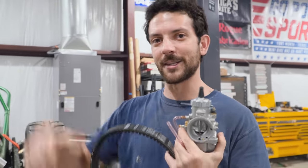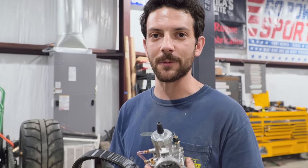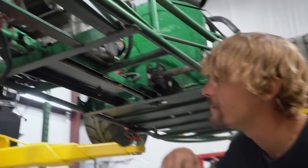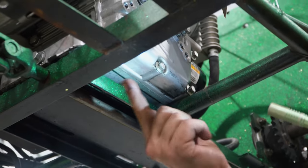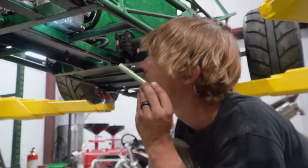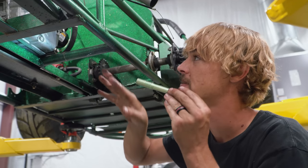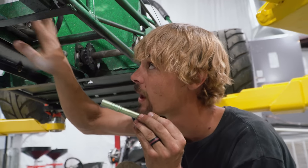If you want to check out the 780 torque converter or 34mm carburetor, there are links in the description to gopowersports.com, and anytime you place an order let them know in the order notes that Cars and Cameras sent you. Now that we've got the engine lifted up and the torque converter taken apart, we noticed an oil leak — it seems like it's the side cover gasket. We wiped it and it's still coming up a little bit, and it dripped quite a bit over three days. It's not coming from higher up near the bolt holes, so it's not the oil filter or the head gasket — it's definitely something low.